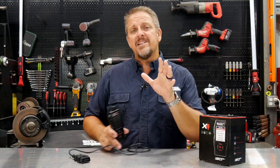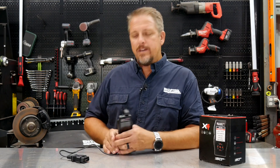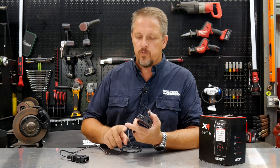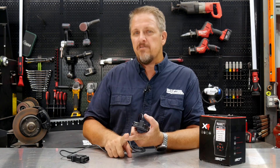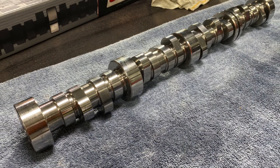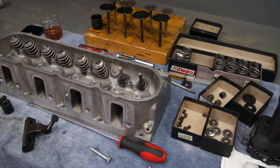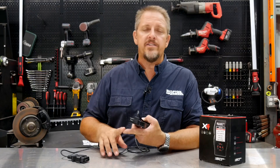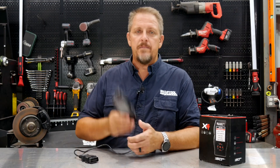Let's take a ride along. This is a 2011 or 2012 Cadillac Escalade with a 6.2-liter GM LS-series engine. We installed a complete upper-end package — basically a displacement-on-demand delete — where we deleted the system that cuts out cylinders, and we installed a higher-lift cam with more duration, essentially a stage-two cam, along with lifters, push rods, new valve springs, and rebuilt roller rockers with a trunnion kit from Comp. We needed a custom tune.